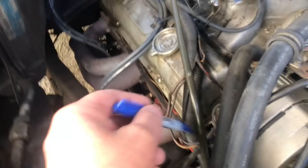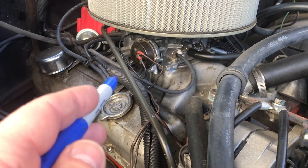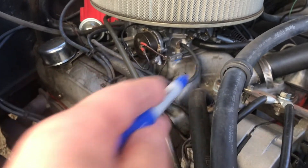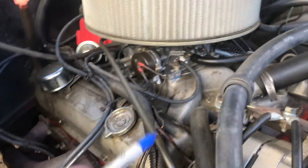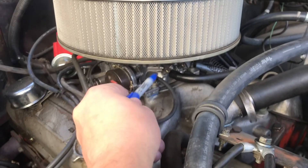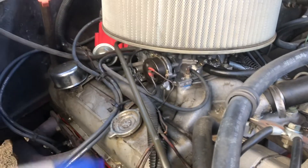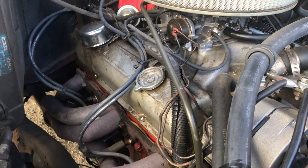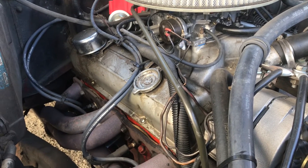You've got your fuel pipes coming up near hot headers and the hot intake. The center port of the intake has exhaust gases going across them, so the fuel in the carburetor will get hot too. That's why I'm putting a spacer back in here — I got one coming, an inch higher. That's all to fight issues like that. This works now — it's fine — but I always had hot starting problems and I just don't want to add to that. I think that's what I did. So not a big deal — the pump is $20. We're going to put the right one on there.